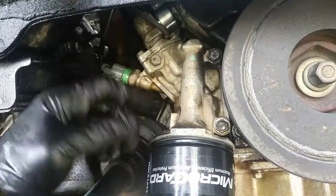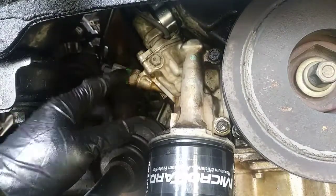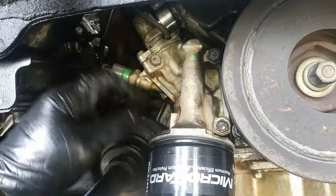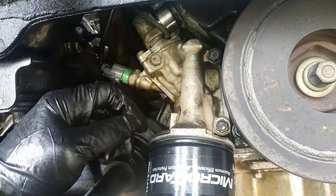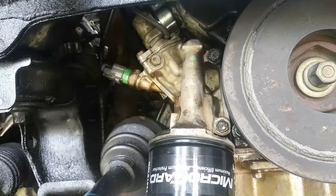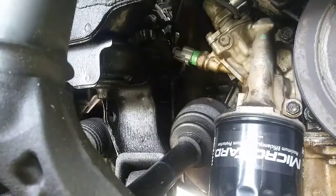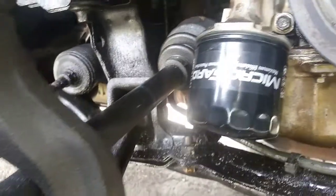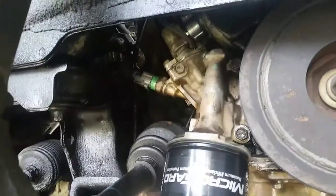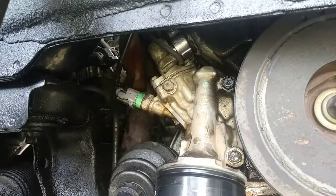And it looked like after clearing everything off that the rear main seal is plausibly leaking, and of course the VTEC solenoid here is leaking. So I got a gasket set on the way, and I'm going to address this. The car also has, you can see remnants of oil in the back down there. Hopefully it'll pick that up. You can look down there and see quite a bit of oil accumulation. So it's been dripping and making its way back on the frame and falling off.